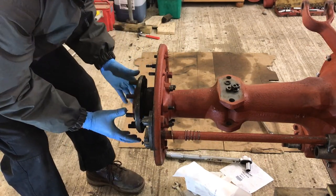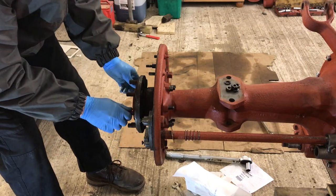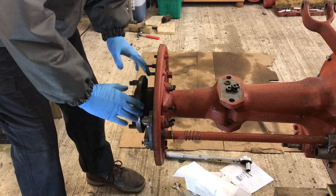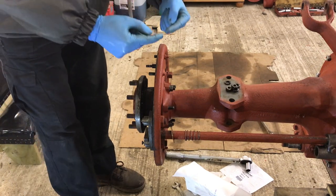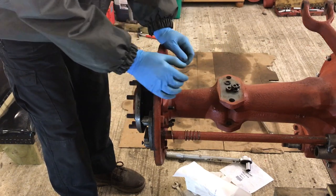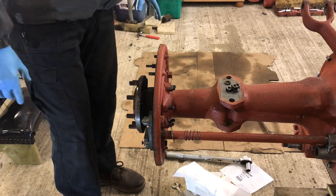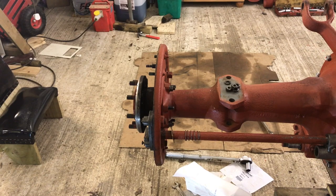Now we will have a little bit of play in this axle — you can see and hear it. We want to pull that out. Bear in mind we haven't changed the bearings on here so they haven't been disturbed — they're okay. Now we're going to do exactly the same thing on the other side. The two ends of the two axles will probably touch in the middle — they should touch — but the end play is what we're going to be measuring, and as I said that'll be the next video.